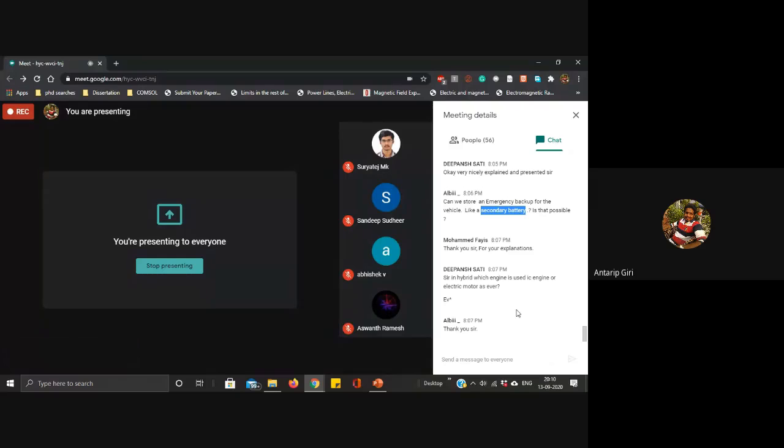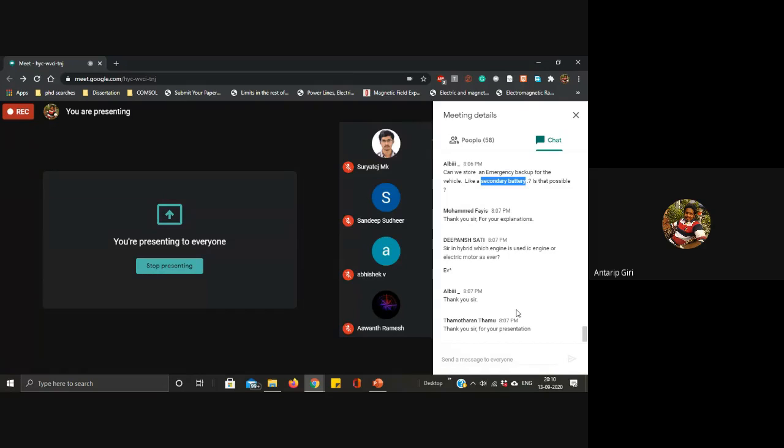Hybrid electric vehicles will have parallel configuration, series configuration, depending upon the kind of vehicle. If you take the Toyota Prius, that uses permanent magnet electric motors, because we studied Toyota Prius motors while I was doing my masters. So that uses permanent magnet. Nissan Leaf uses permanent magnet. So mostly, apart from Tesla, vehicles will use permanent magnet motors, or e-bikes will use BLDC motors. Teslas use induction motors for some reasons. There are benefits with induction motors as well, but mostly European manufacturers and Japanese manufacturers will use permanent magnet PMSM motors.